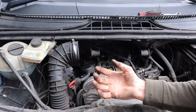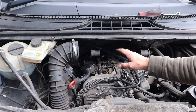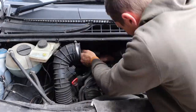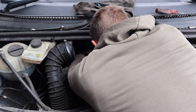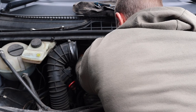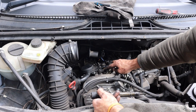You can also get a product called Super Crack-It — it's a bit like brake cleaner but it fizzes up the carbon build-up and makes it a lot easier to get out. I'm going to get the other three loose. Three are out, and to my delight the last one, which I thought was going to be a pain, has just slipped out. This isn't one of those YouTube videos where I say they all just pull straight out — that took me about half an hour of wiggling them backwards and forwards. Number two was hard.